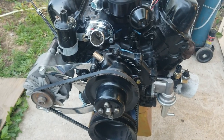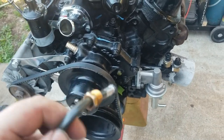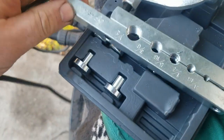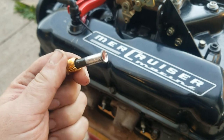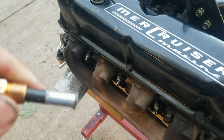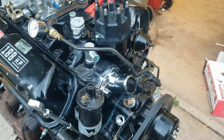If not, we'll have fun later. I got a fuel line bent up here, trying to put a flare fitting on the flare end. I've got this PT brand double flare kit but it was not clamping very well on the tube - it was just pushing it through when I tried to do the fold. So we're going with single flare and hopefully it works. Got it on there, not too bad.